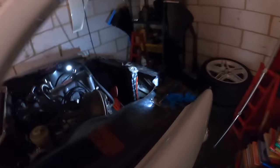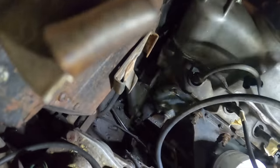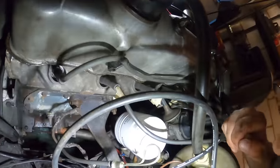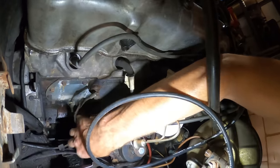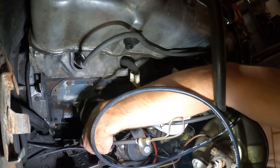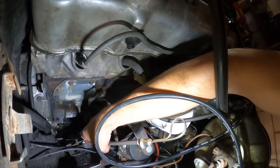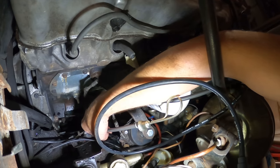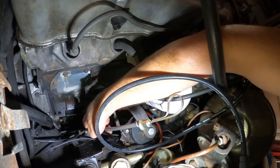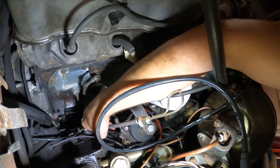Smoke! Smoke smoke smoke smoke — I'm seeing smoke but where from? From this side — ah yikes! Oh — it's the earth cable! The earth cable is almost on fire and it has melted through! What's it melted through? The fuel line! Oh my god, that is really hot — lucky enough fuel was coming through because the earth line actually has a holder in it for the petrol pipe.